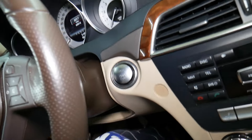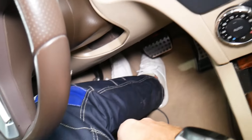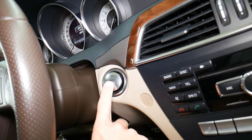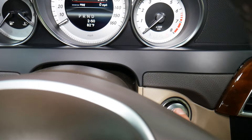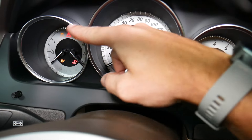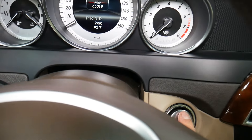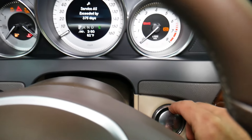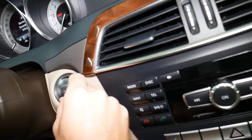If you have a push start button, we'll explain how to do that. If you don't have the push start button, we'll cover that too. Do NOT hold the brake pedal — do not hold the brake pedal — and press the engine switch one time until the lights come on. If you press it two times and all the lights come on, that's position two. We need position one. Turn everything off and click one time without pressing the brake pedal.